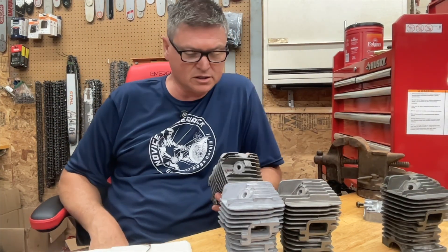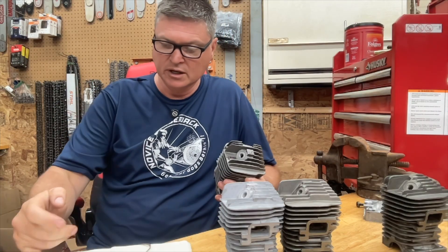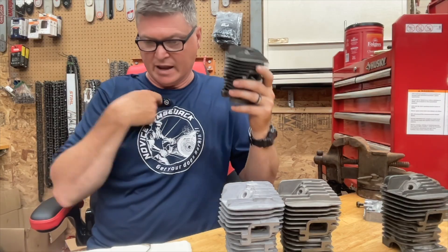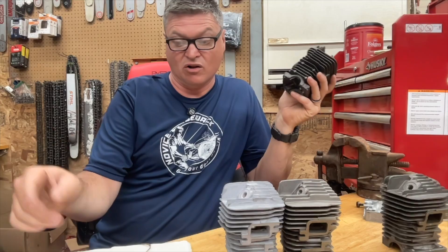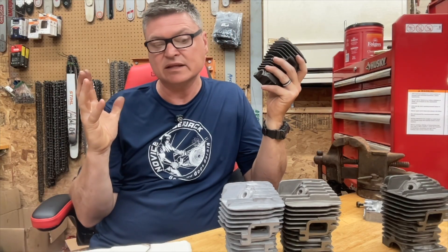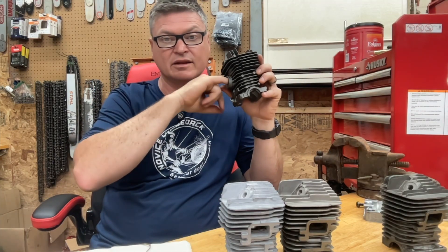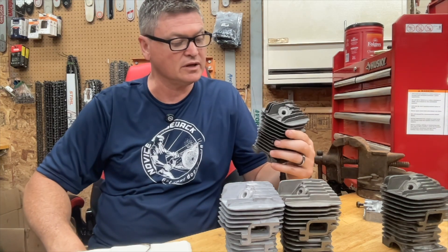101 on the exhaust with a high compression piston is going to give you really good compression and it'd run really well. The only thing it needs — it's got 76.8 for the intake, I'm calling it 77 on the intake. If I wanted a little bit more, I would just take a little bit off, but honestly 77 on the intake, I bet it would flow really nicely.